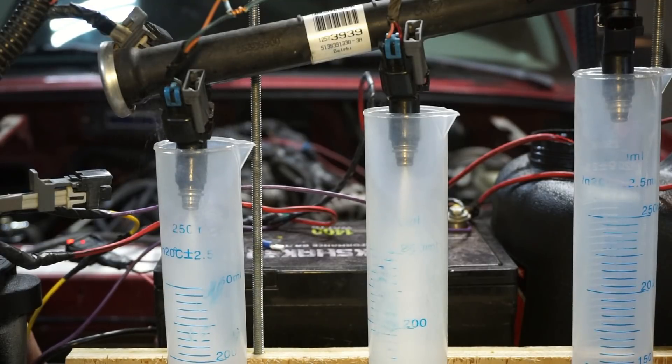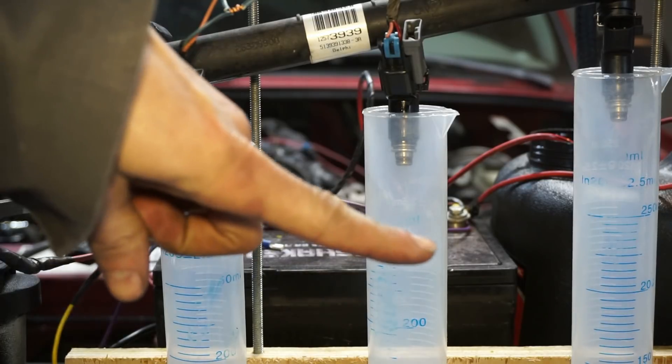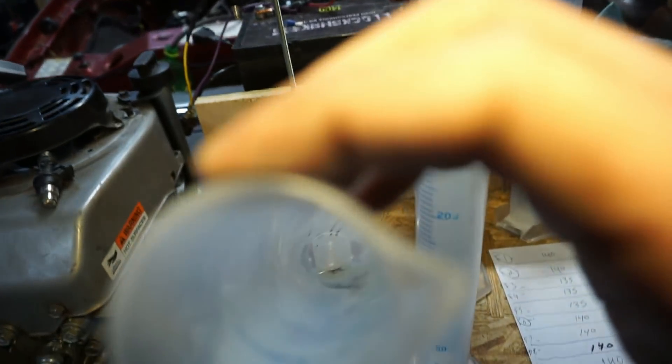Sure enough, works fine. On some other sets when I turned it on nothing would come out, or just a trickle, or the stream would be shooting sideways — then I'd pulse it and it would start to spray. And check this out — see all that junk down in the bottom of the graduated cylinder? That's all the stuff coming out of the flex fuel injectors. They're launching a bunch of crap because they're sticky. Make sure they get properly cleaned — there's concern that as they clean out during the test, the later readings won't be accurate.